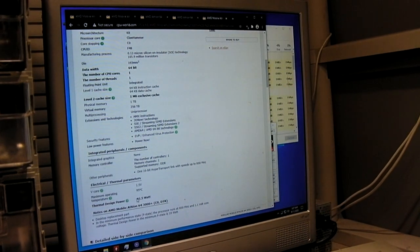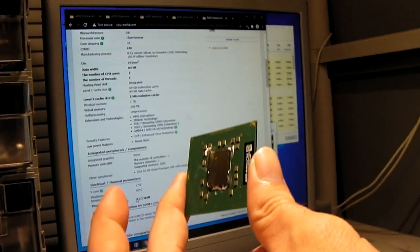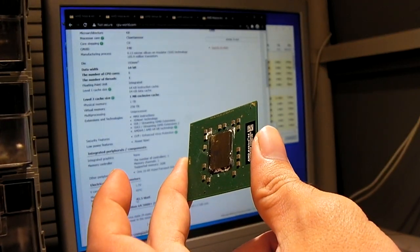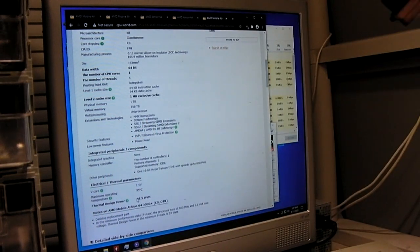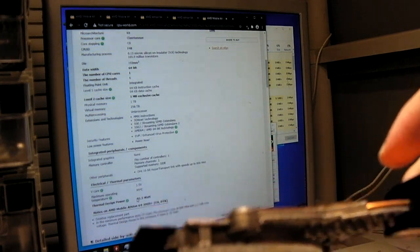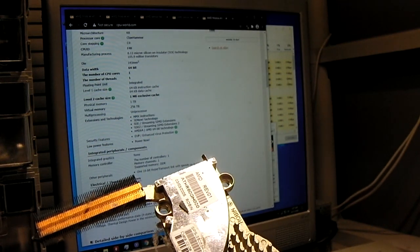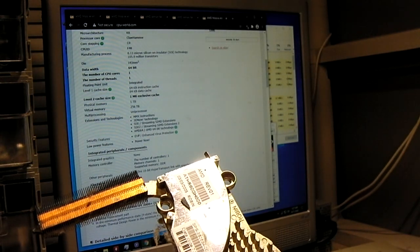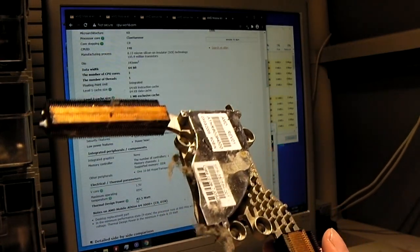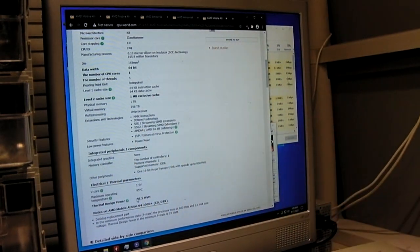out of this laptop. Now I'm sure somebody is going to ask, well Nick, if you can stick a Mobile Athlon 64 into a desktop, could you put a desktop Athlon 64 into a laptop? That, I don't know. I think one of the limitations would be our cooler. Considering, for example, the Venice Athlon 64 has a similar TDP, its max operating temperature is lower at just like 68 degrees C. So you very well could overheat the thing. I might try it sometime later on. I don't know, but...